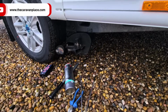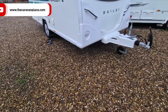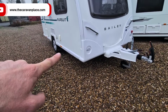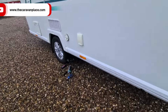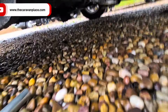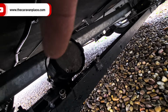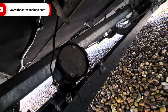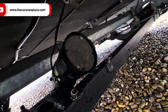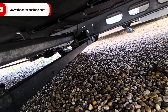Motor mover trouble. So what's basically happening is when the caravan is moving, one side is working, which was that side, and then this side isn't working. We just had a very quick look, and luckily it's just the little connectors. On the back of the motor here, and then on the opposite side are the little connections, and basically just giving those a quick little jiggle and the actual mover all started working okay.